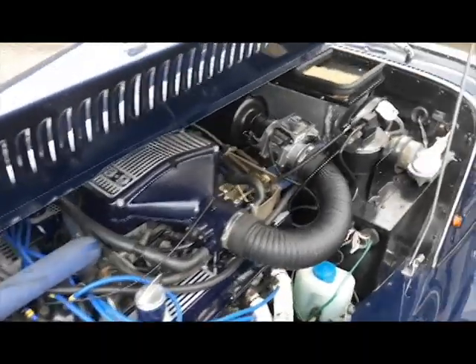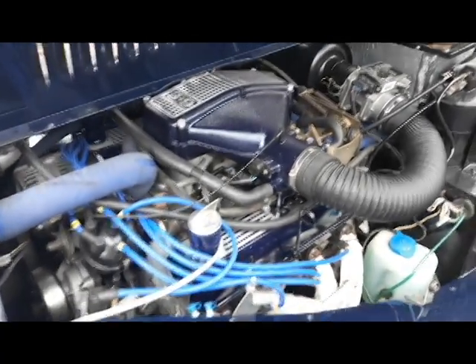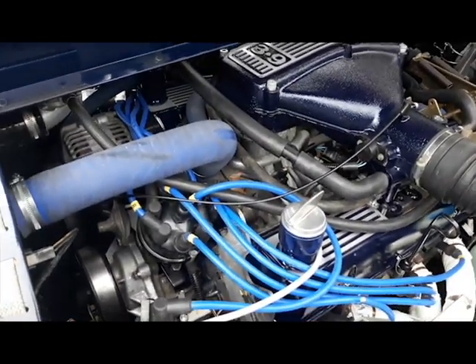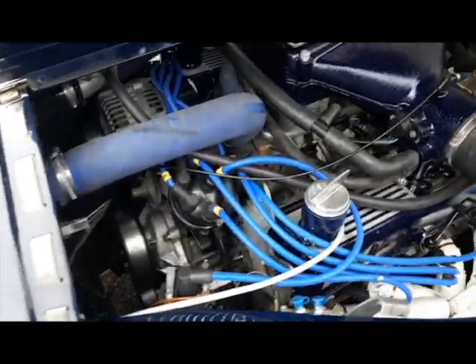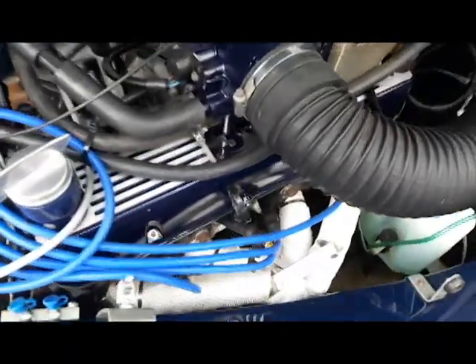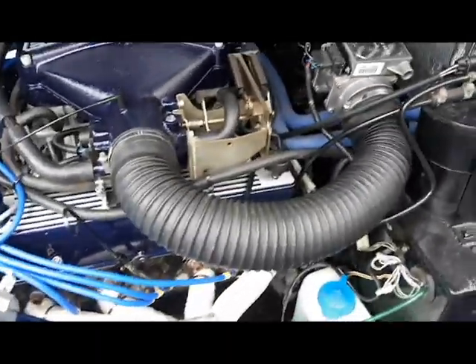Back to the Morgan. Obviously 3.9, we've done the Tornado ECU chip. We've done the A&R amplifier — I don't know if you can see it down there — and the Bosch coil. It's had Magnacore plug leads. We've done some engine detailing; the guys in the workshop have done a really nice job on the plenum chamber and the rocker covers. And as you've seen via the Facebook photo library, we've done a Piper 270 camshaft, which really opened up the mid-rev range. The customer already had some aftermarket manifolds made and a sports cat down there, so the exhaust flow was already perfectly adequate.